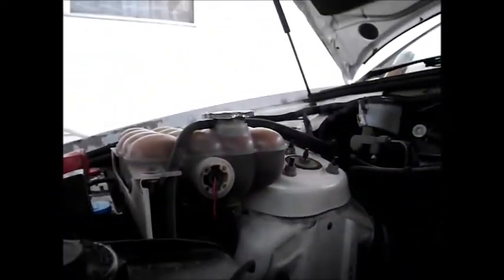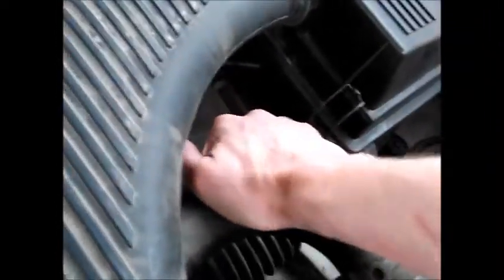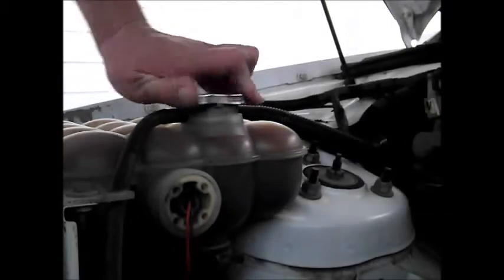If we stick this up here and zoom in — here's a radiator cap. Now, before you take the cap off, it's always a good idea to make sure the engine's cold like this is, and give your radiator hose a squeeze and make sure it really is genuinely at zero pressure. Because otherwise, if you take that cap off and it's hot, you can end up with all that boiling water coming out. The pressure will stop it boiling, but it might be sitting at 120 degrees or 110 degrees or whatever. When you release the pressure, there's nothing to stop it boiling, so you'll end up with a geyser of boiling hot water. So let's take the cap off.